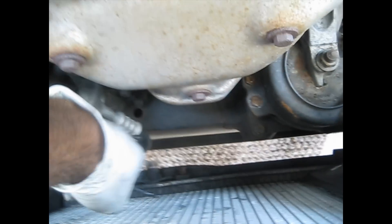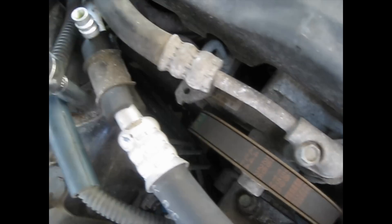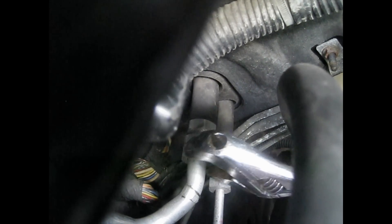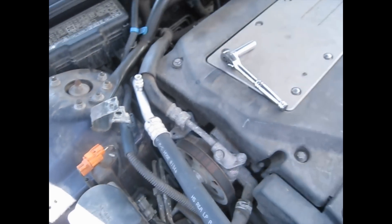I think this bottom one here is leaking too, so I took off this piece. Now you gotta take it off on the back — got a big crescent wrench like this and just break it loose. You don't wanna wrench it too much, just gently, because you don't wanna break the lines going into the evaporator. Just shake it a little and it's gonna come out, and the whole line is gonna come out.